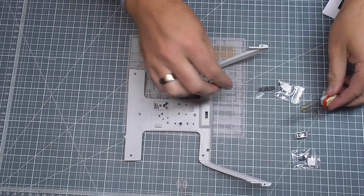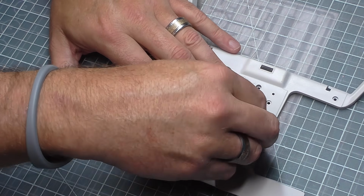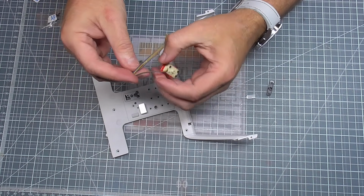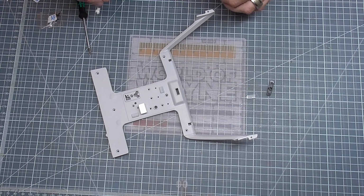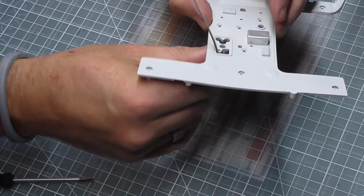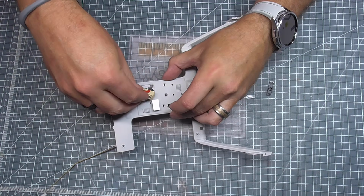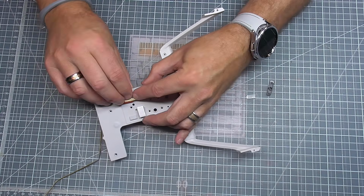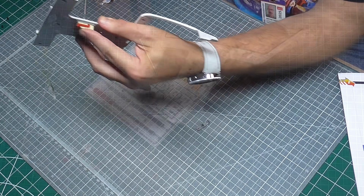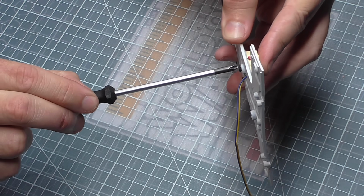And the first thing I'm going to be doing is putting this silver box into place. It's actually going to go right into the position here. It's held in from the other side with a BP screw. And then I've got this whole section here, which has already got electrics in for us, which is really good. What we're going to do is put the plug through this side here, all the way through. So then I can actually put this into place just on top. And again, there is a locating lug, so it can only fit one way round on here. And again, I'm holding that in with a BP screw as well. Through that center hole there. Use my PH1 screwdriver.